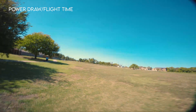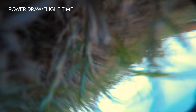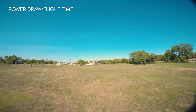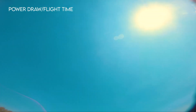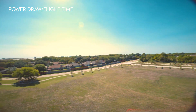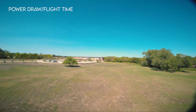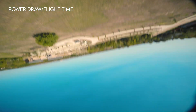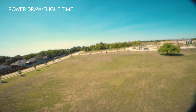Power draw is really high. I was getting less flight time than before, but it's nothing major. My drone is relatively heavy. I run a 1500 milliamp hour, 100C, 4S battery. I was getting roughly around three and a half to four minutes before, and then at 100% motor output I was getting like two and a half minutes max, which was concerning. I like having relatively longer flight time. That's why I put the motor output down to 90% — I started getting consistently around four minutes of flight time.